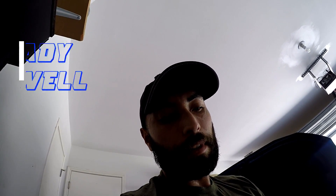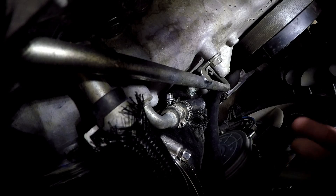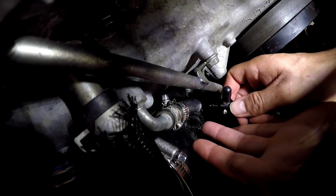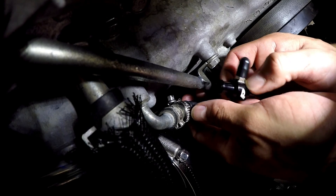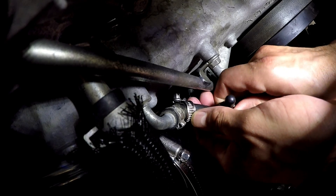We're going to want to make sure we have the clamp already ready to get fully clamped onto the turbo sump vent hose — one clamp oriented above the restrictor. Then we're going to have to cut a little bit more so we can join the turbo restrictor to the vent hose. Make sure that Perrin logo is facing up when you install this turbo sump restrictor.